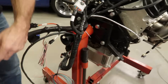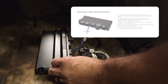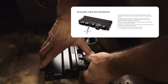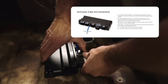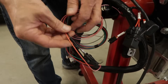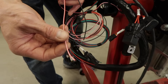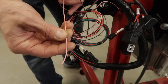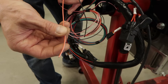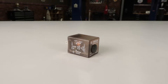Once you've verified that all the sensors are connected, you'll need to run the J1A and J1B plugs, which are found on the opposite end of our main harness, to their corresponding connectors found in the Terminator X ECU. In the main harness, you'll also find some loose wires. Your red with white tracer wire needs to be connected to a dedicated switched power source. Be sure and verify that your switched power source has 12 volts in the run as well as the cranking position. If your vehicle does not have such a source, you'll need to install a relay to provide the ECU with one.